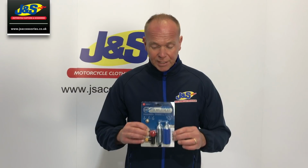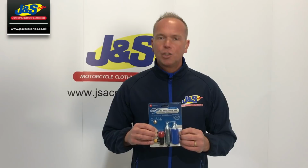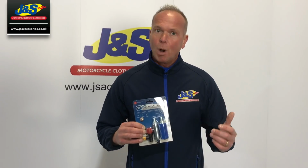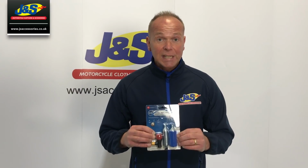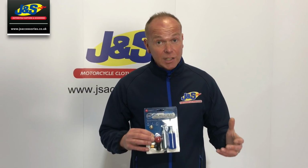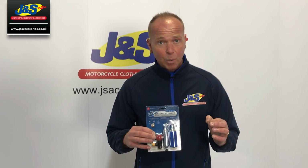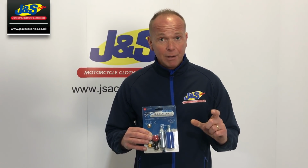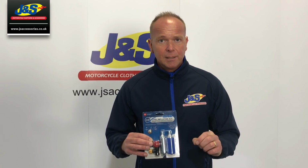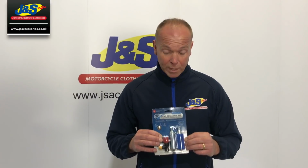One thing I will mention is if you are using these canisters to re-inflate the tyre after the repair, these canisters don't know how big your tyre is. They don't know if it's front tyre, rear tyre. They're not going to give you an exact pressure is what I'm basically trying to say. So you're going to use the canister to put air into your tyre to a degree where you feel is safe enough for you to ride to the nearest garage and put the correct PSI in, okay? So I would also carry with you a little tyre pressure gauge so you know where you're up to, okay? That's something that you need to consider and think about when you're buying these kits.